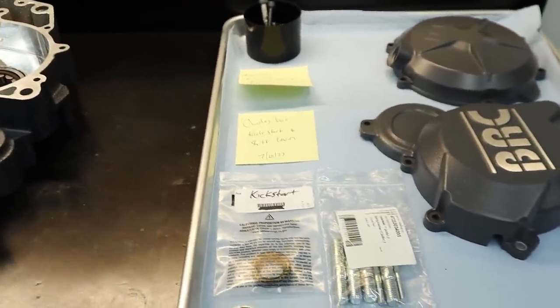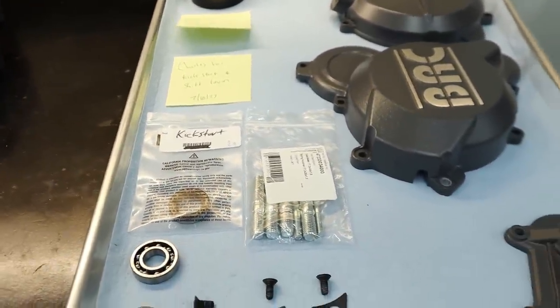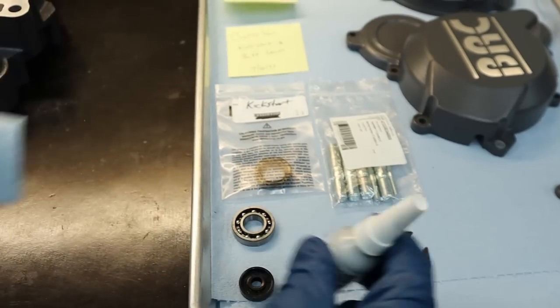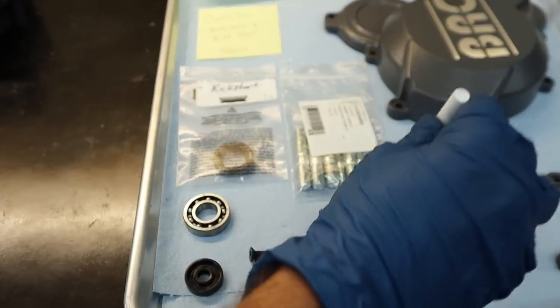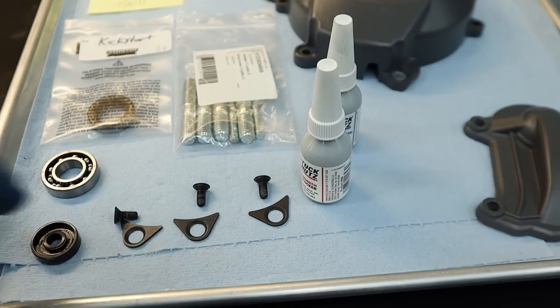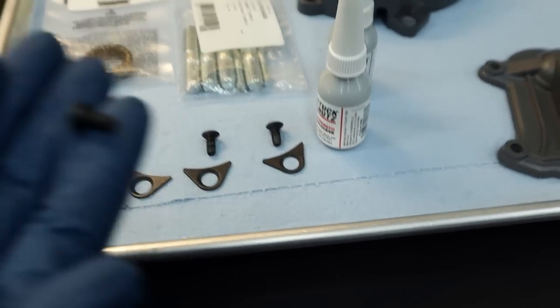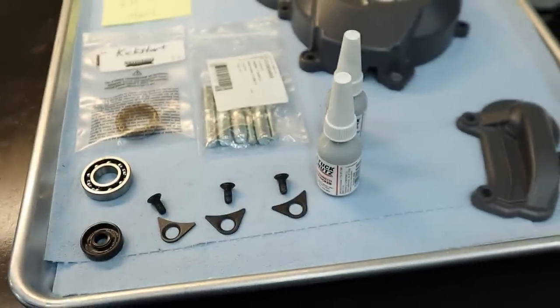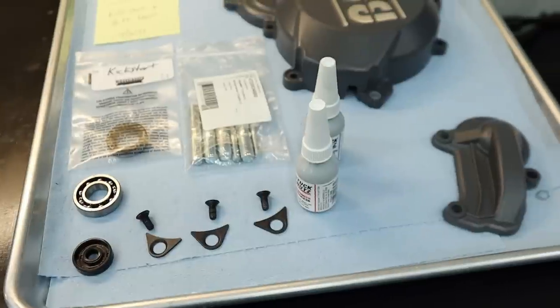I would go red. This thing's going to go, who knows, the last bike was in Pennsylvania and probably never ever see that thing again. So this way, it's more of a guarantee that we're not going to have a problem. Red is basically full strength, full steam ahead. Gotcha. I would rather there be difficulty getting a bolt like that out than easy.